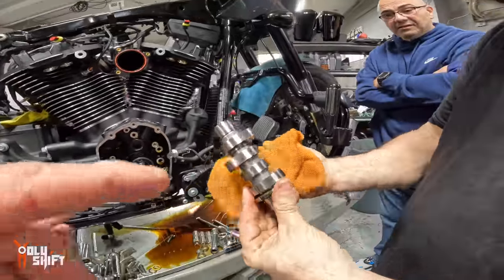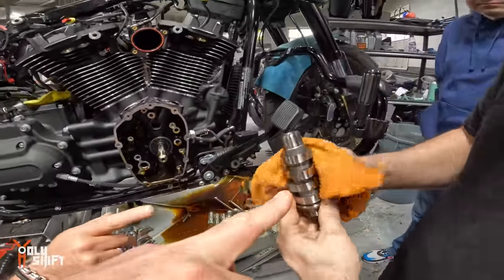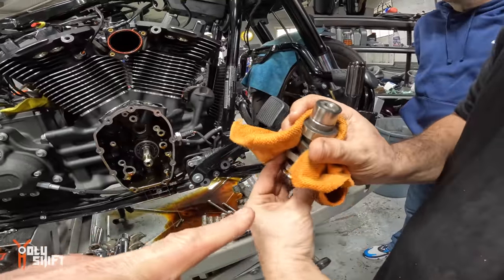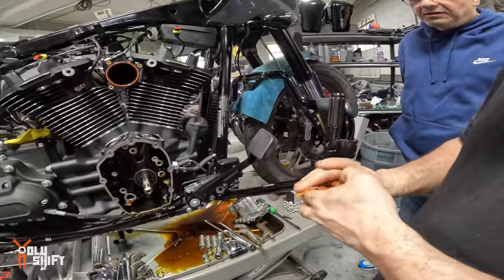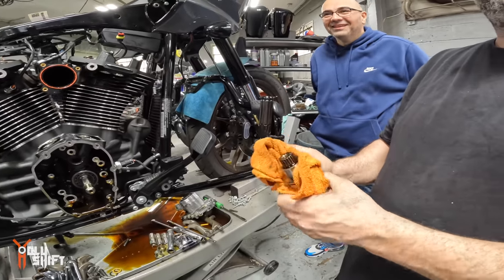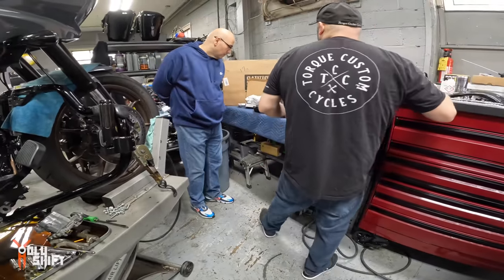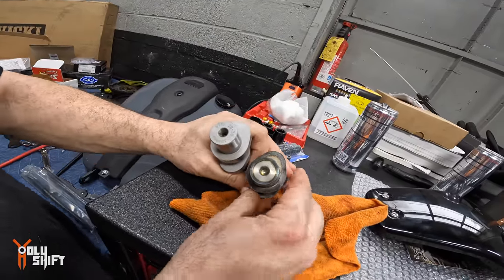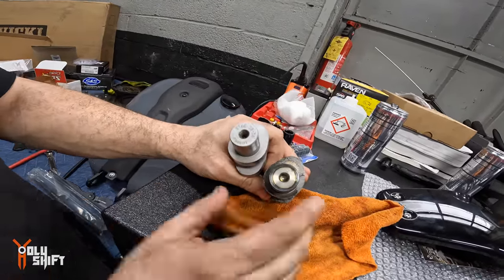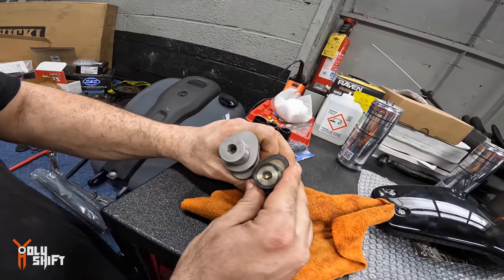Let me see if there's any wear or not. Okay. Yeah, that is actually their Stage 2 torque cam that comes standard on the ST. That's probably why you're getting 115 foot pounds. So it looks good. It doesn't look bad. Wider. Your base circle is the same down here. That's why I can use those push rods. But look how wide and tall.